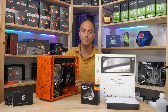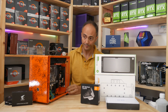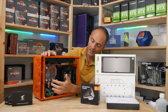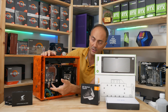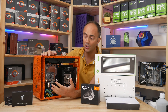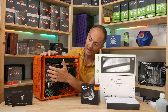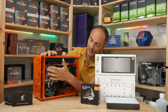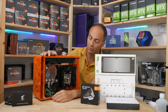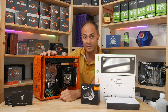I've just added some mounting tape on the side of it to fix it in place, and as you can see, it's super secure. You can basically put it wherever you want in the case. The only downside is if you have it next to the side window like I've got here, you do lose a few of the ports — but you've got two at the bottom for the inlet and outlet for the pump and reservoir. Thankfully, in a Mini-ITX build you can fill the PC on its side, which is what I'll be doing. I can just lay the PC on its side, fill the fill port, have the system bleed itself, and away we go. Super great device from EK Waterblocks — very useful for Mini-ITX PCs where you can't fit large tube reservoirs.